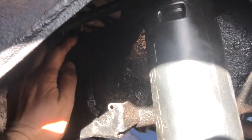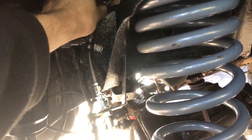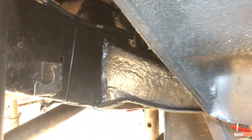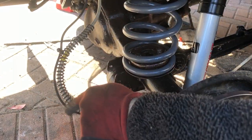There's no movement here, and where I couldn't get a P clip I've just put it in a piece of nice fuel rubber and a cable tie going all the way down so it doesn't move. Same everywhere else - managed to get a little P clip in here so it can't really move. Over there it's in a piece of rubber strapped down, well away from the fuel lines and wiring loom.